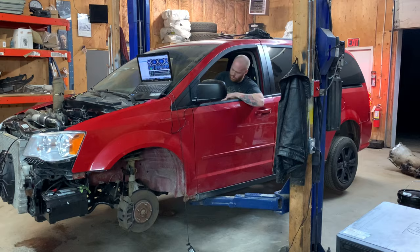It pushed through the brakes. That's cool. When I put on the brake while it was in drive, when I revved it up and put the brake on, it kind of wanted to stall out, but then I locked the brake on and it kicked back up. I do have the torque converter lockup wire hooked to the brake pedal, so I know that's not an issue. But this is stuff that tuning is going to fix up.